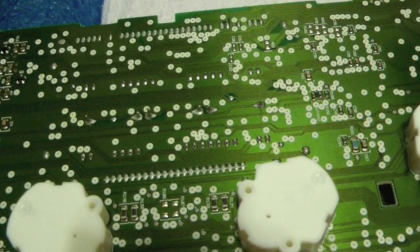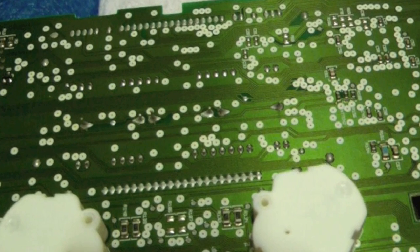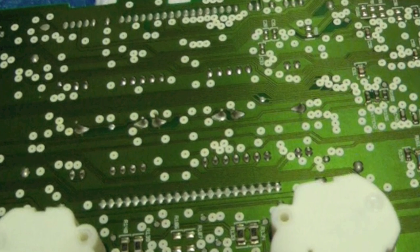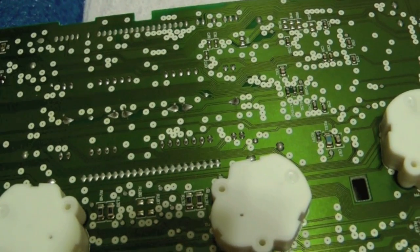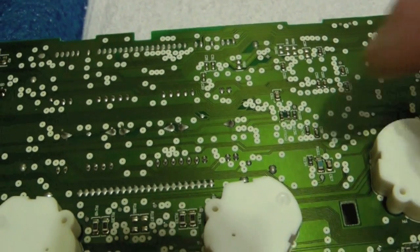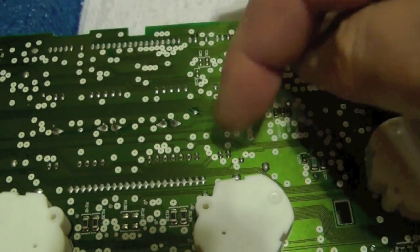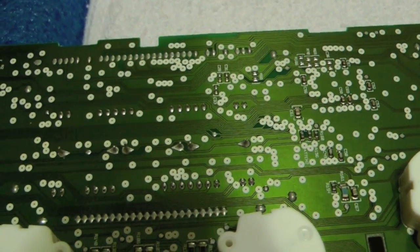I want to be really clear on this issue. If you're just soldering for the dim odometer then just pull the clear plastic off the back and solder these points — you don't have to do any of the disassembly of the speedometer itself that I've shown. If you're not sure you can just hit each of those with your soldering iron and try to melt them back, maybe just a teeny dab of solder as well. Be careful though because these are so tiny that if you start blobbing solder on there you may short circuit those and connect them together, which would be worse than just having a dim odometer.